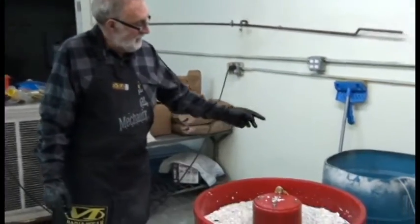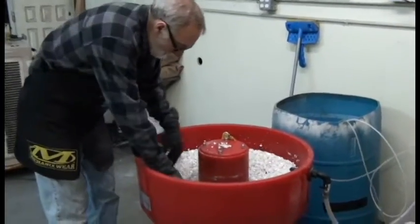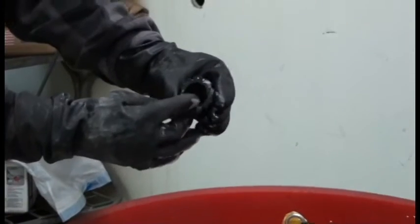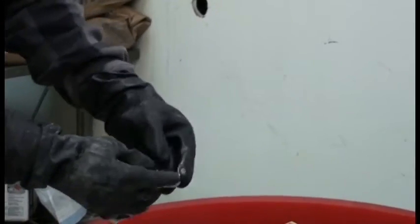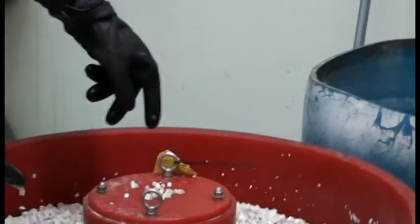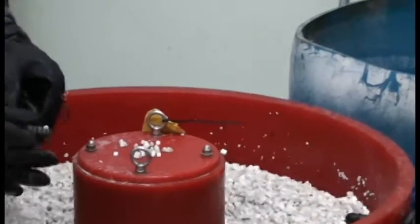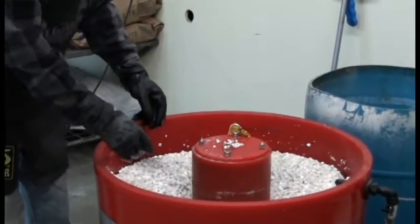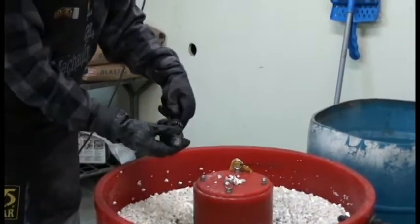The first step of isotropic finishing is we put the parts into a tumbler. We have an acid that goes in, and it takes the parts and makes them turn into a black finish, like this. We do this for a specific amount of time — usually around five to six hours in each process. We have to be mindful of how much fluid we're putting in and taking out of the machine. We're always checking the parts and taking the ceramic beads out. Next, we're about done with this process — as I said, it turns everything black. The next process will be the polishing process.